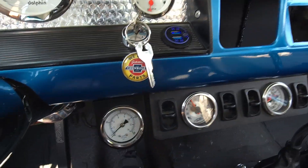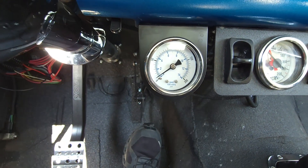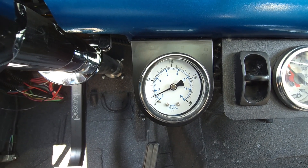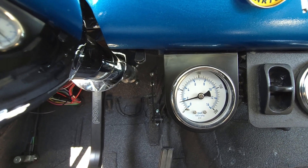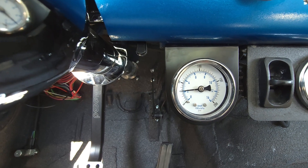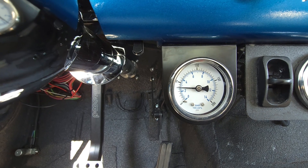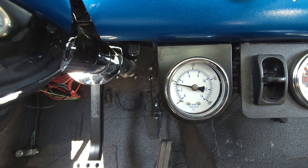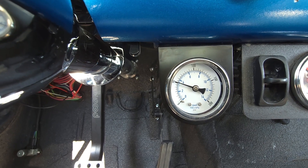Now we're going to try the York, starting basically at zero. Notice it's much quieter — you can barely hear it on the video. I can hear nothing when the York is turned on. It's the same as an air conditioning compressor kicking in; you can barely tell when it's on and off. I'm considering putting in a run light so I can tell when it's engaged in case I forget to leave the switch on. This is at idle — when driving, the York spins a little bit faster because engine RPM is higher.